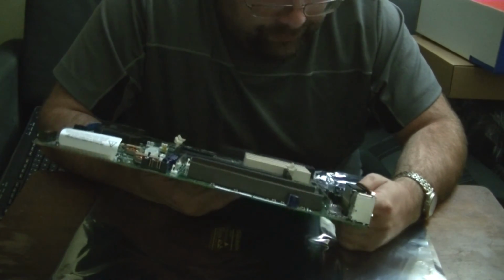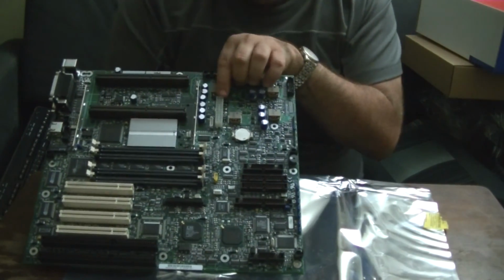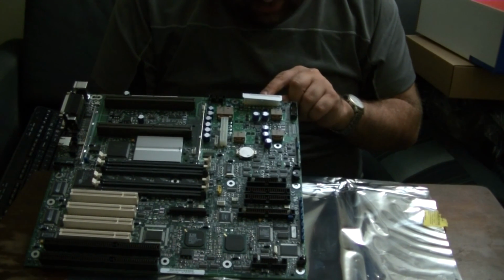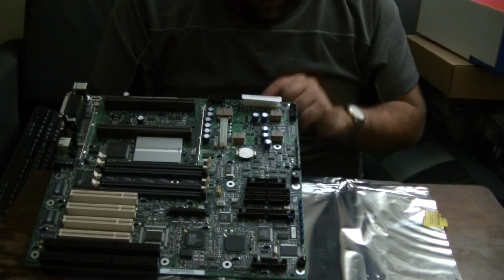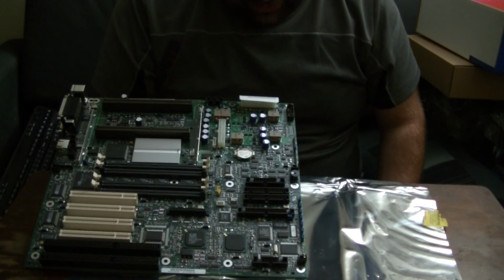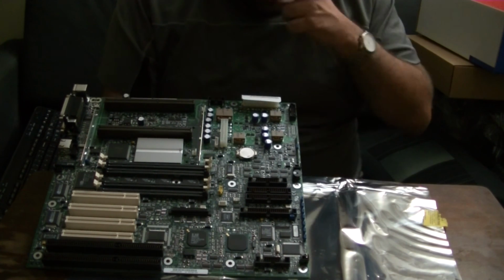It's 1998, so we have a Cirrus Logic. Okay, well, let's put it the right way. So we have an integrated Cirrus Logic with its onboard memory, which is great for a server board. And we have our 20-pin ATX connector here. And it says here, use this 24-pin power connector only with Intel Columbus 2 KCOL or Intel Astor power supplies. For the Astor power supply, use the 20-pin ATX connector on this board. So you're telling me.